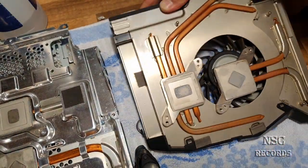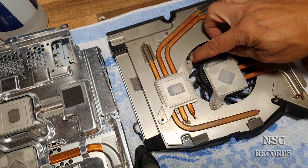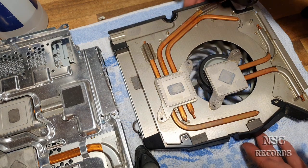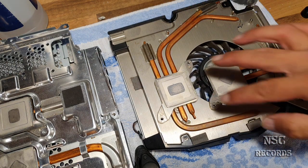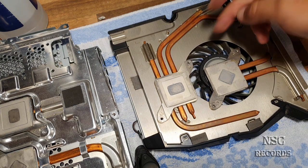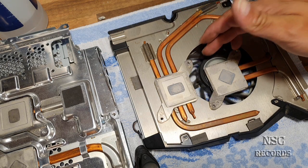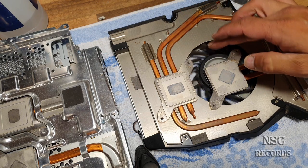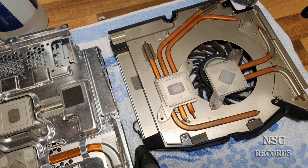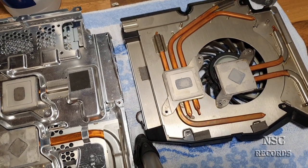You can see they are glued or soldered — really fixed hardcore to this part, because that's how all of this works. The heat gets transferred through the wall cooler here and the fan is able to cool the heat sink on the back and also the heat pipes. You need to imagine the heat going there and the fan bringing fresh air back.